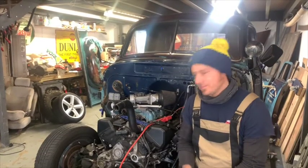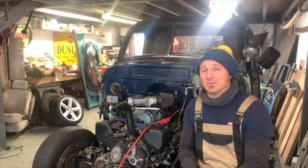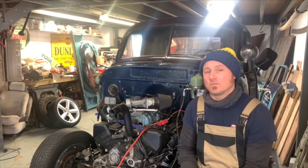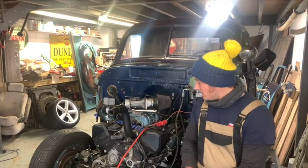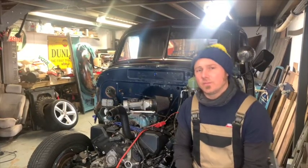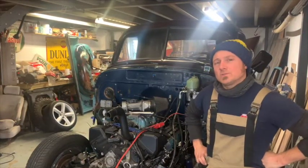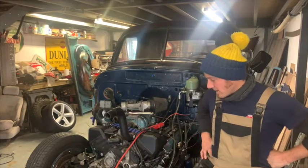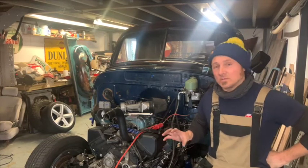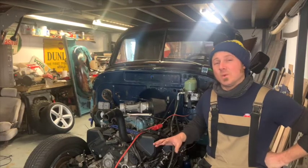So yesterday, we linked up the power steering lines and I ran it up and the steering went crazy, jumping around doing some weird things. I got these lines hooked up around the wrong way, basically, the flow and return. So it's still not quite right and I'm not quite sure if it's pressure related. I've got these pumps put out between 1,000 and 1,200 PSI and the Mustang racks, I believe, are at their happiest around 700-800, and if you put a bit more pressure in, it just makes the steering lighter. I don't think it makes it do anything weird.